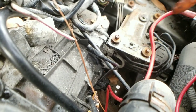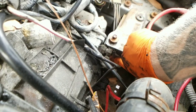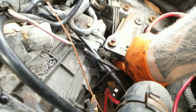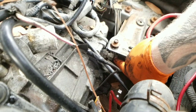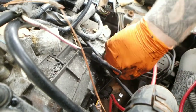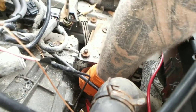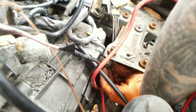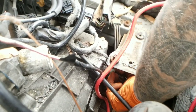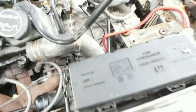You see right here, you have your cooling lines right here, but right here is your plastic retaining clip. All you need to do is squeeze the two tabs together, okay, and that tube will come out. So let's see if I can do this with one hand here. The vehicle is old, so those tubes have been in there a second, so you need to squeeze them, shake them a little, okay, and they'll come right off, okay?